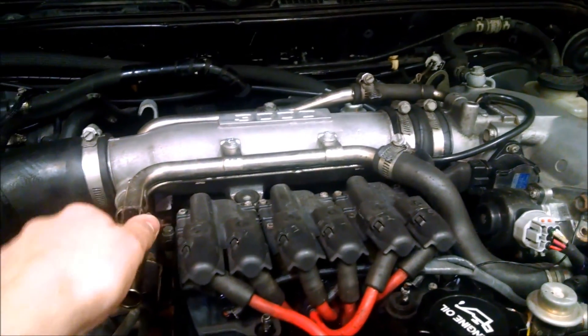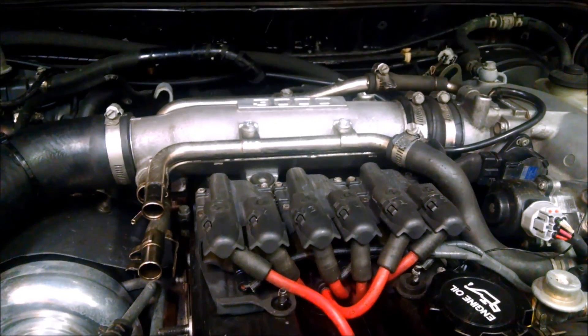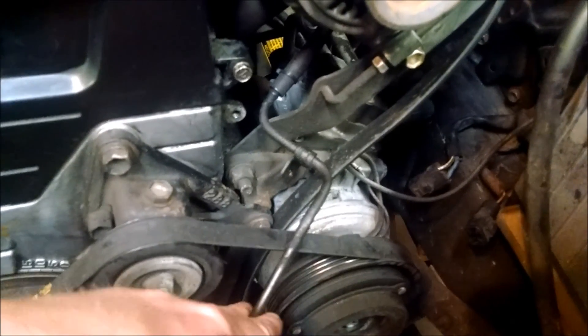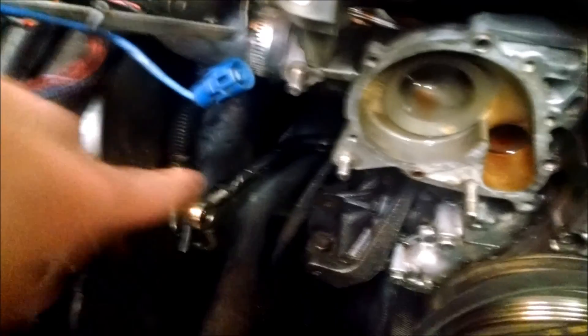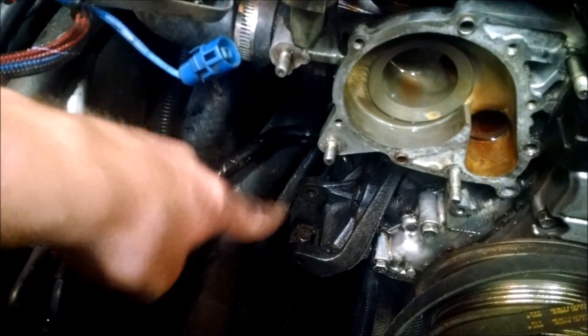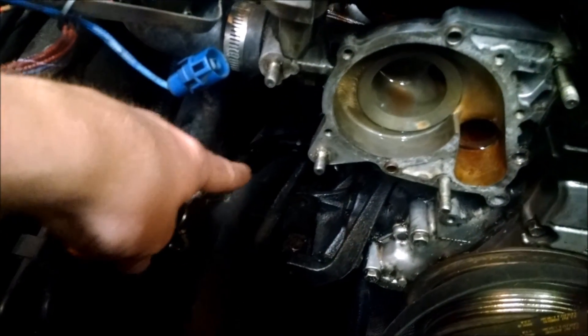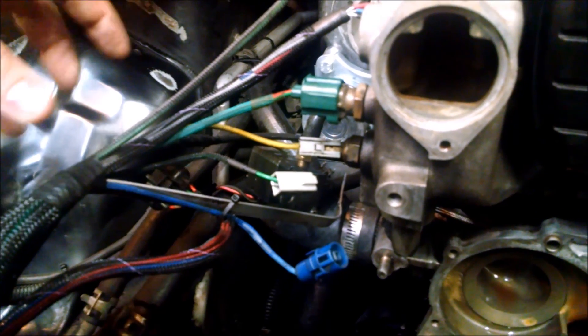And you're not going to lose anything on here. So there you go — I think that's what you need. Oh, and the power steering — that normally comes down here. The metal pipe that goes across that front cover of the engine. My power steering pump is out right now, that's why I've got this all apart. But normally you'd have power steering right there, and the vacuum hoses go there. And the other end goes up to the accordion, and there's a port on the bottom of the accordion for that over here.